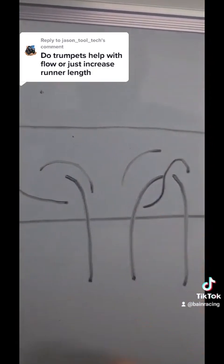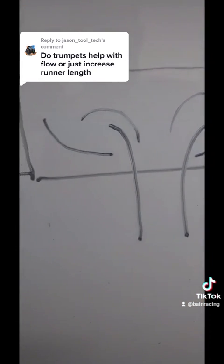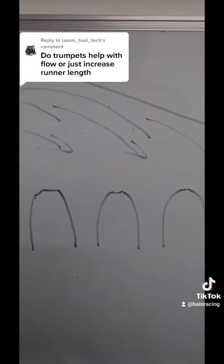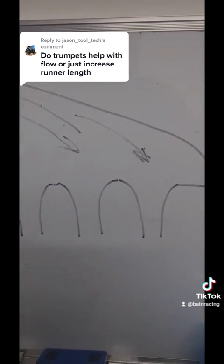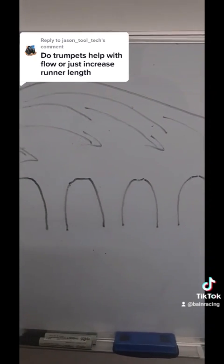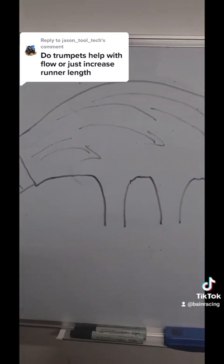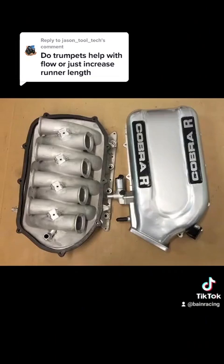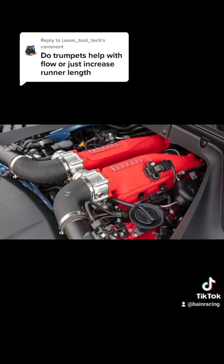The airflow path is extended over a well-designed tapered plenum. Something like this has a really good expansion zone — we slow the air down from 200 to 300 feet per second to sub-150s, 125s, and then it can make the turn a lot more stably. Then we're adding a velocity gradient front to back. Just remember, the front of the manifold needs four to eight times more air than the back of the manifold needs.